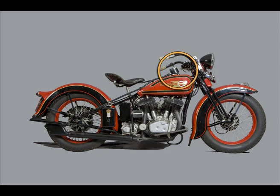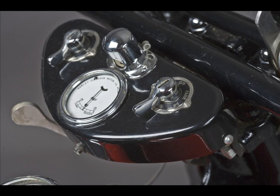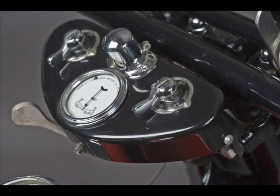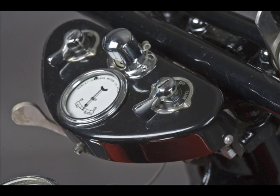Now we're looking at the instrument panel. It has the white-faced ammeter, introduced probably in mid-1934, but not announced as a new feature until 1936. There's no spacer under the ammeter, and I don't deduct either way. Note that the dash panel has the round-headed screws on the side. That's another mistake in the parts book.